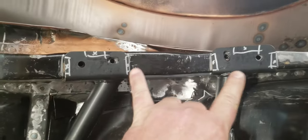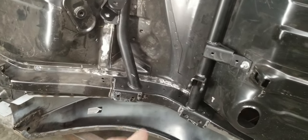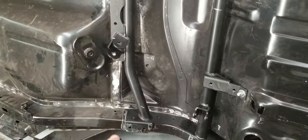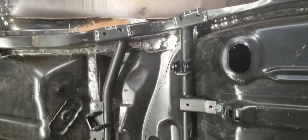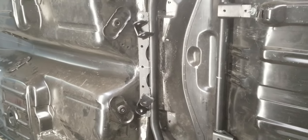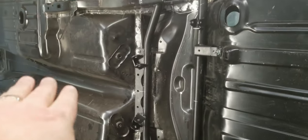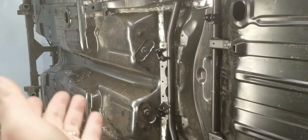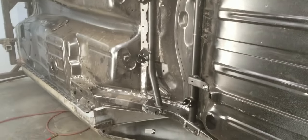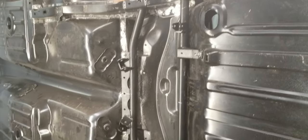I got that little hole welded up there, looks real good. I went around and marked out where this four-link cradle is going to sit and where I want to weld it. I'm going to pull it off there, wipe off the e-coat from the frame rails as well as the powder coat from the cradle in those areas. Give it a shot of weld-through primer and then whenever the time comes I'll be able to just slap it up there and weld it in place. I want the car sitting level so I can jack up underneath it, put pressure on the cradle and fit it nice and tight up to the body, using the weight of the body to press down and hold it in place.